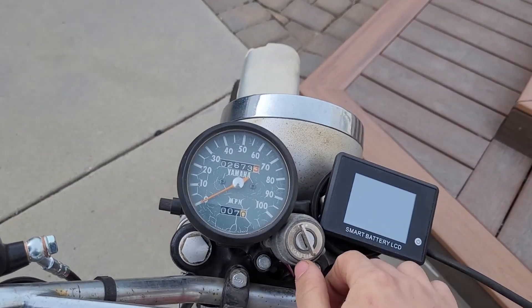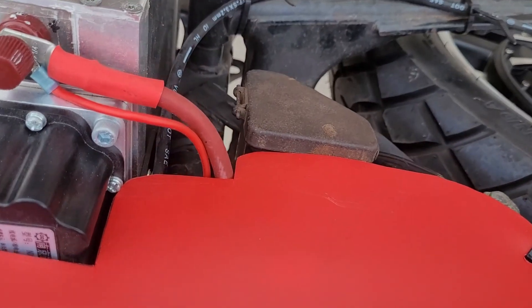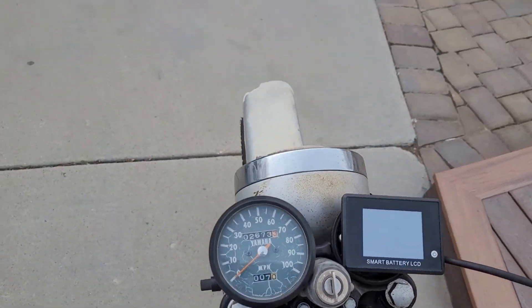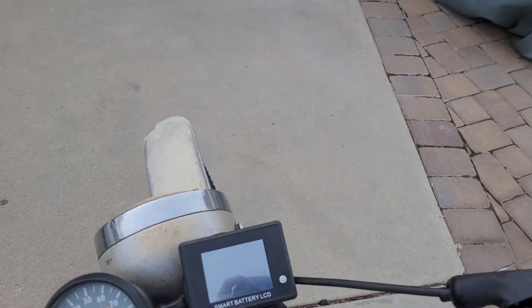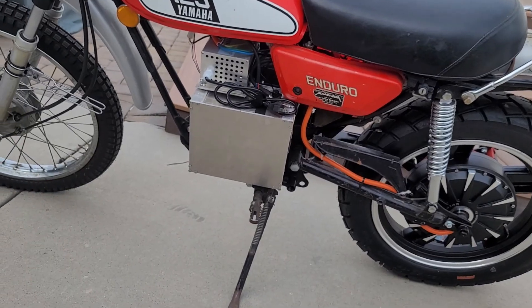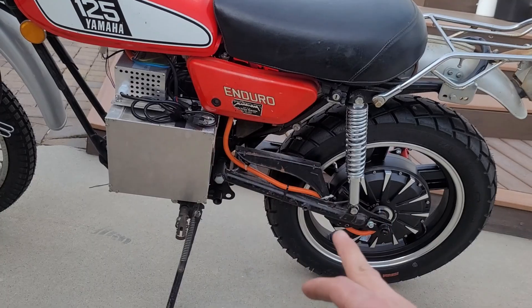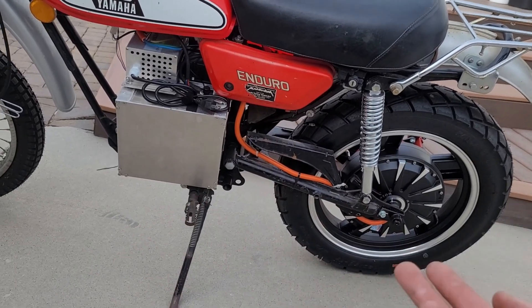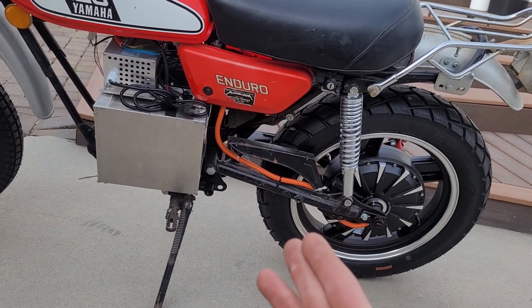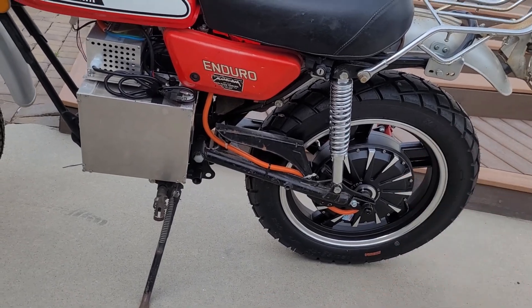To turn the bike on, I just turn the key switch. You can hear that click — that is the contactor. And now the bike is live. It moves just like that. Another thing with the rear hub: it's completely dead silent when it moves. You can hear a lot of things around you. There is no chain running, so you don't need to worry about lubricating a chain. The chain also has inefficiencies — you probably lose about 20 to 30 percent on a mechanical chain — so I do get more range because of this.